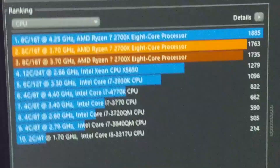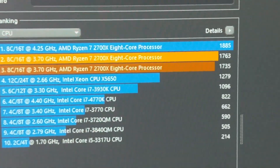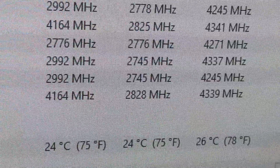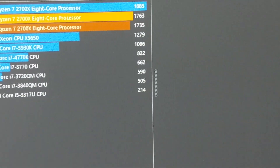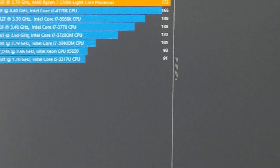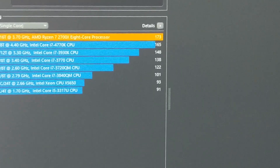I'm recording this on my phone — long story, not going to go over it — but this is on the X470 board with the Cooler Master ML240L. You can see I did hit all-core boost; it peaked at 4.3 GHz but hit around 4 GHz. That's the multi-core score — up about 30 to 40 points. The score I'm most interested in here is 173 — that's stock. That's XFR on an X470 board with the Master Liquid 240L.